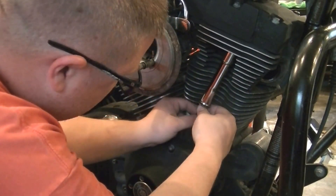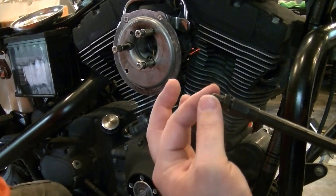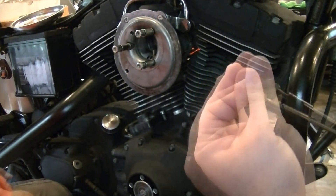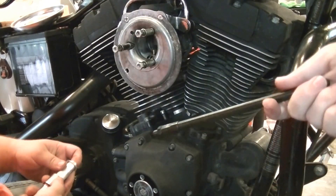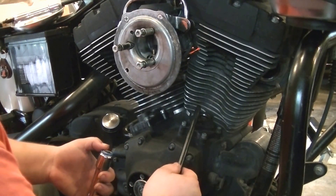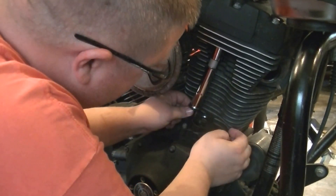You've got to unscrew the actual bottom — the lock nut is just a lock nut, the whole center piece is threaded. The lock nut is not what you're spinning; you're actually spinning the entire rod inside. Actually, install the intake side first because it's behind the exhaust side and that makes the intake side relatively difficult to get to. Get your push rod up in there — the ball has to be in the rocker cup. Do the intake side first, coming around from the back side of the tappet block, and keep it seated in the rocker cup while you're doing it.